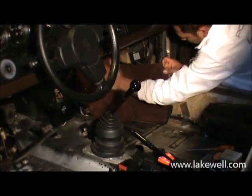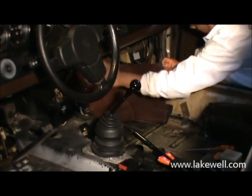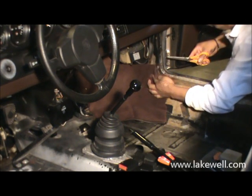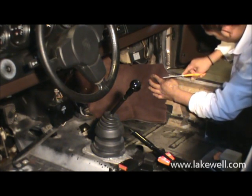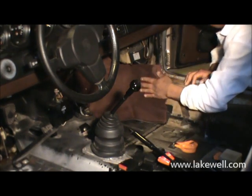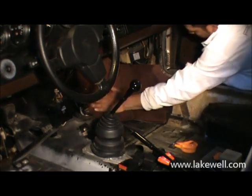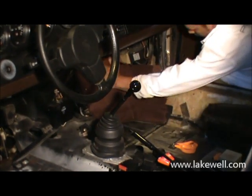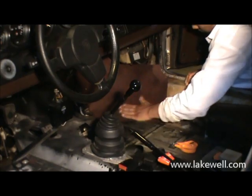And then you just press into position. You press fit the carpet piece. You'll notice that around the point where the A-post goes over into the sill, Robin makes a little cut to make sure it follows the contours.